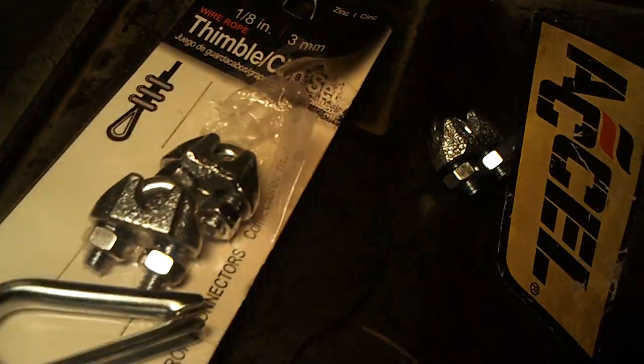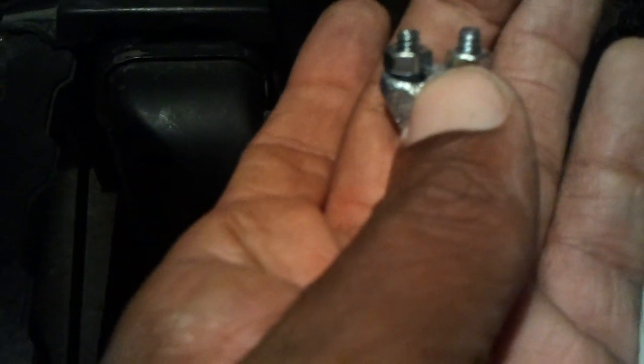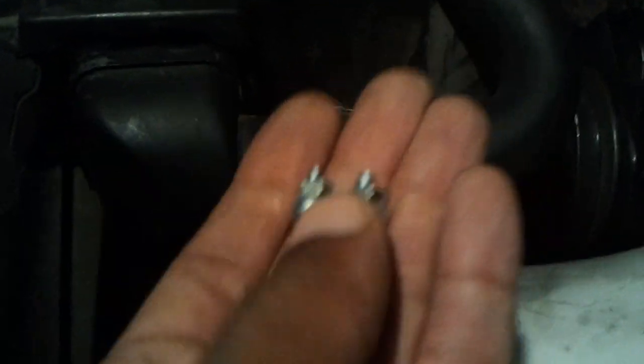It's one of those metal clips. What you do is you take this little piece here and you hook it on the back of that line back there, tighten those two bolts down, and it holds the sucker in place. Whenever you have those TV cables or detent cables, they tend to pull out sometimes.